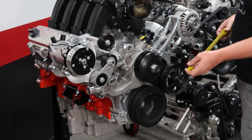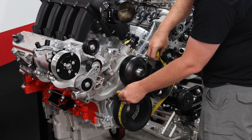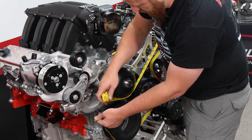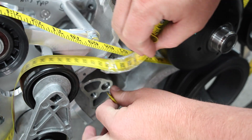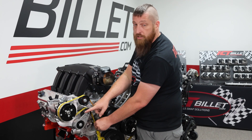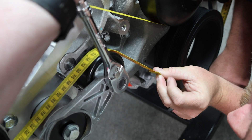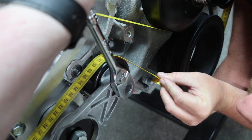I usually like to start at the crank here and follow my belt routing with the tape. Sometimes it's better to have more than two hands, but around the water pump here, up over the idler, AC compressor. So we've got the tailor's tape wrapped around the accessories. We need to get this tensioner all the way maxed out and see what this tape measure reads. We got the belt at maximum tension and it's showing right at 96 inches — maybe a little bit more. That'll be good enough.